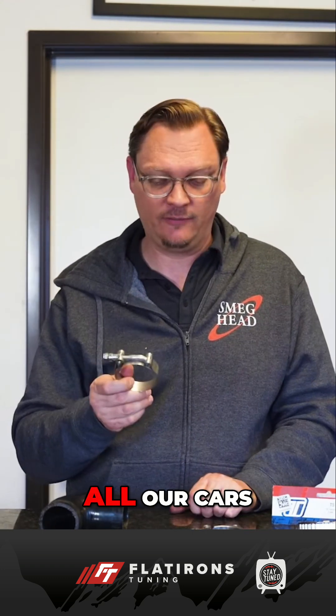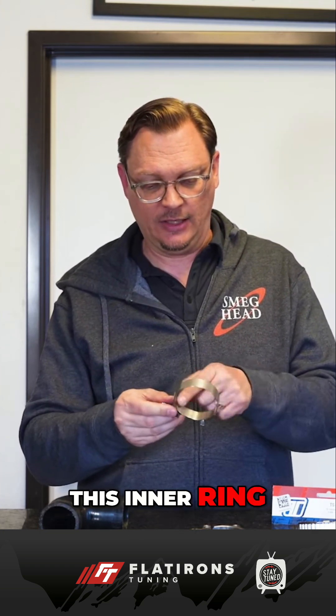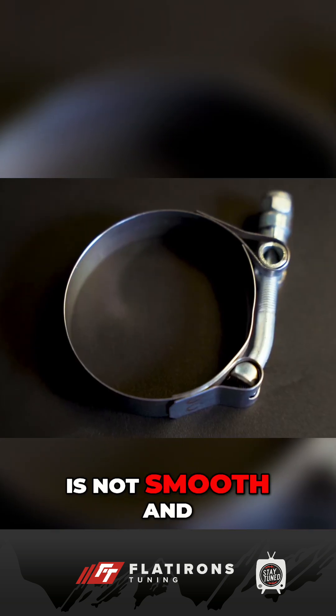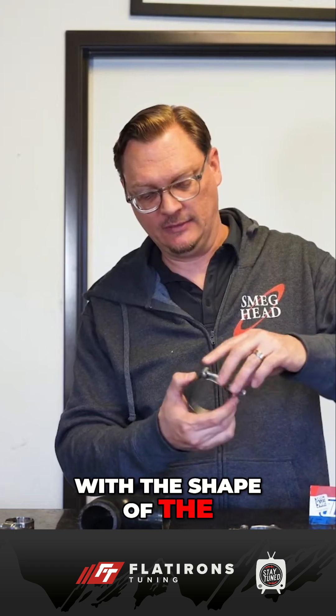For a long time we put these on all our cars, especially the race car, and then we ran into another interesting issue with T-bars. Even though you have this inner ring to slide over the hose, you can kind of see that it is not smooth and round anymore — there are some little bends in it. This is what can happen with the shape of the T-bar as it gets tight, especially if you're trying to use it close to its maximum adjustment: you can actually get a little bend in it.